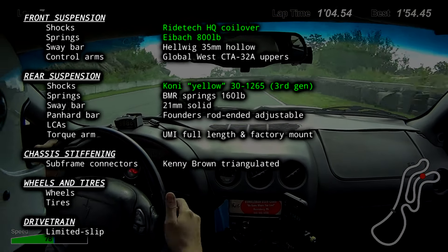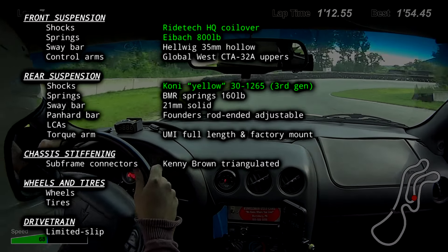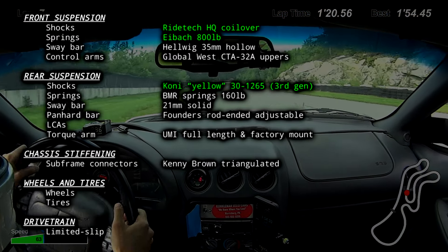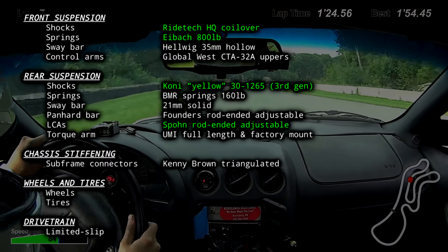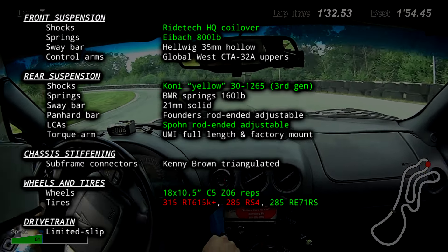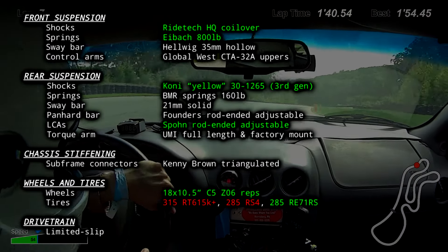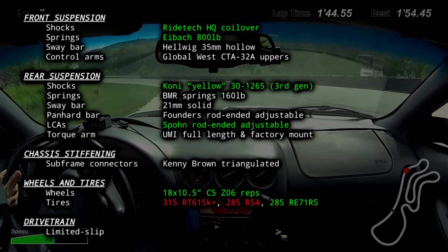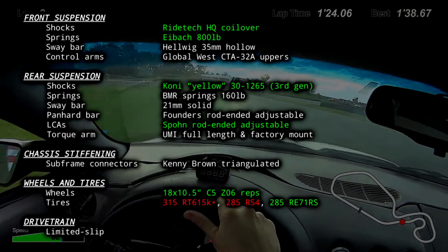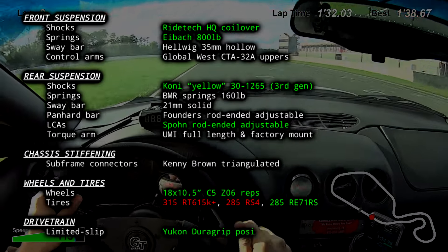For LCAs, the three-piece poly arms would occasionally bind and cause snap oversteer, especially during lift-off — the outer poly cups were soft at first but eventually hardened with time. I considered going back to stock rubber bushing LCAs, but decided against it due to the higher probability of wheel hop or brake hop. I went full race car instead with rod-ended LCAs, and the rear is much more predictable now, though the ride is pretty harsh on the street. I also went with wider wheels and I'm currently on 285 Bridgestones. A quick side note: 315s are way too wide for a 10.5-inch wheel on a road course — they're too squishy and unsettling at high speeds. Eventually, the stock posi felt a little too loose, so I swapped in a cheap Yukon posi and it's been great ever since.